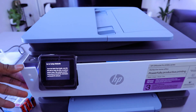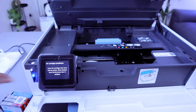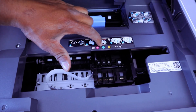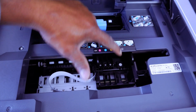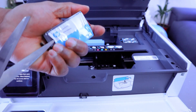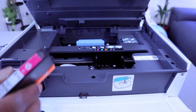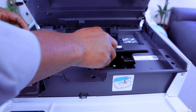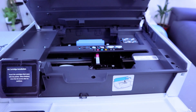I'm going to show you how to set up the ink. If you open up this printer by lifting it up, the ink cartridge holder will move and position itself to the center. These are the ink cartridges that came with the printer. Look at the sticker: magenta is first on the left, followed by cyan, yellow, and BK black on the right. To install, start with magenta — pull off the air vent, insert this end first, then push it down until you hear a click.